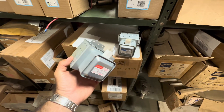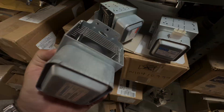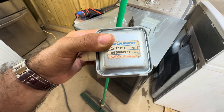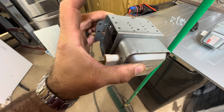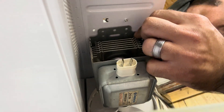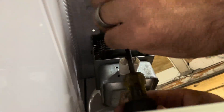Would you look at that. I'm not sure. I don't know if this one will work — it's made in Korea and this one is made in China. But as long as the mounts are the same, the cooling fins face the right direction, and the plug will work, we should be good. Let's give it a go. It's very sharp and very tight in here, so watch your hands and your fingers. I'm sure I'll get cut in just a second. Here I'm just mounting this used magnetron up, and then we'll see if we get some heat and we'll see if we get that noise again. I bet you we don't.